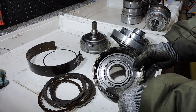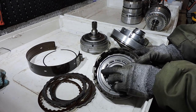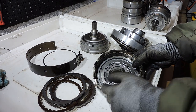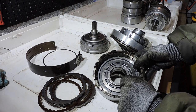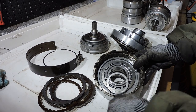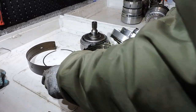Here you see the piston and a return spring with some pre-tension from the caps. When the piston is actuated by fluid pressure, it pushes against the spring, so it needs a certain pressure to overcome the spring's counter-pressure. Whenever you want the clutch to disengage, you simply remove fluid pressure from the piston and the spring automatically returns the piston, disengaging the clutch pack. That's the trick behind actuating the different clutches.